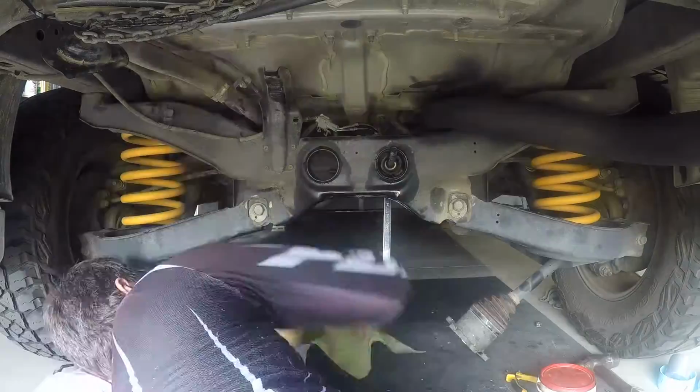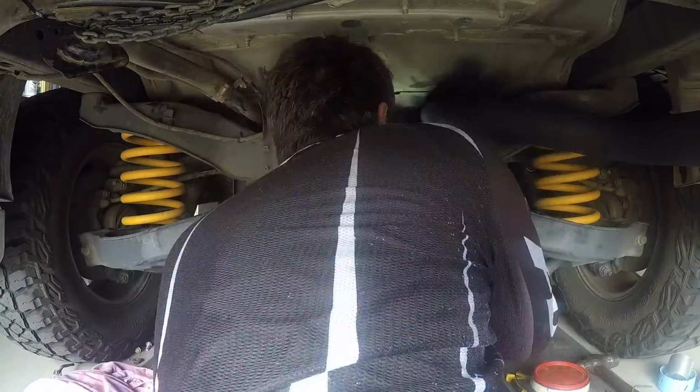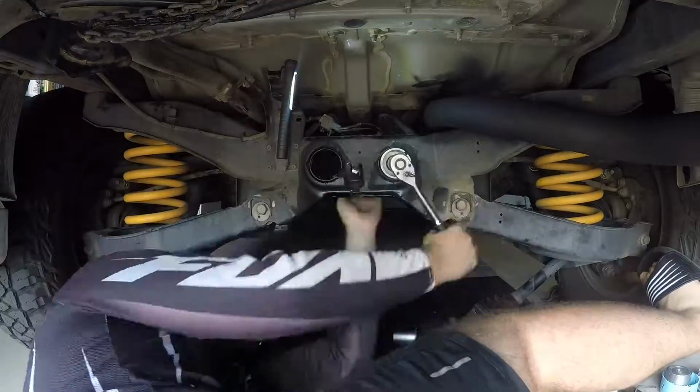Cutting out didn't work, so I bought a Toledo Universal bushing driver set from Repco, and that worked a treat. It was much easier. Still a lot of effort, but much better than using chisels and saws. So give it a go. It's just expensive, but it'll last you a lifetime though.